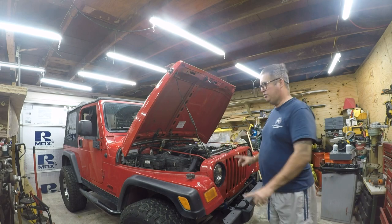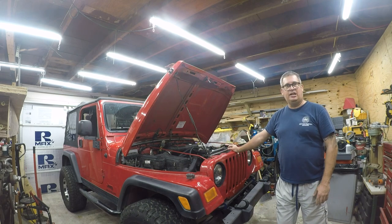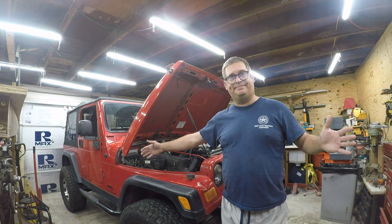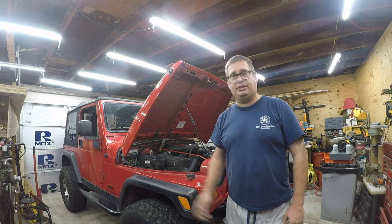So I'm going to support the front axle with jacks or jack stands, and then I'm going to take tires off, and I'm going to make some aluminum rods that are 35 inches long. They can be square, they can be angled. They can be damn near anything you want as long as you can clamp it to the rotors.